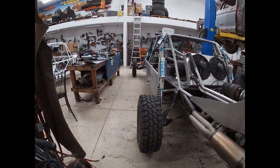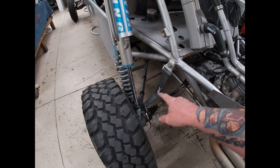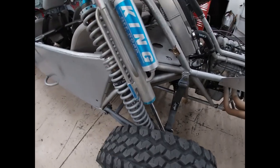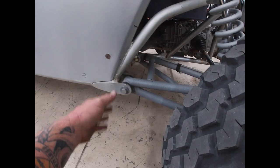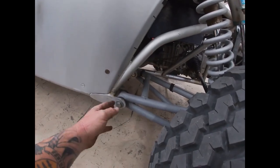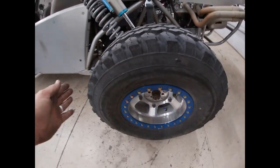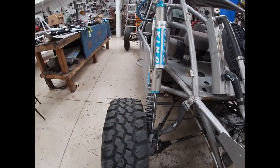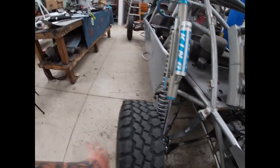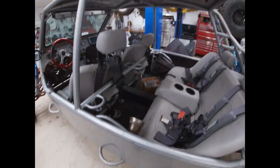If you just maintain your car, and you have midboards with a low horsepower car like mine, you should be able to drive it for years with no problems. When I do the midboard hubs and bigger arms - these are five-by-five - we'll switch to five-by-seven. We base this off a Volkswagen: five-by-five means the arm is pushed back five inches from the factory VW location and five inches wider. I need to go five-by-seven to make up for the two inches we gained by widening the front, so it'll even the car back out.